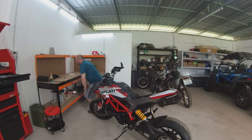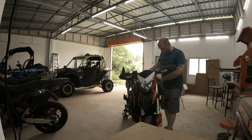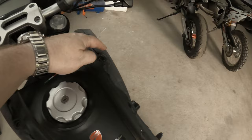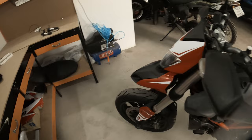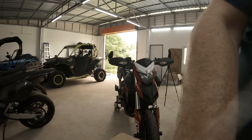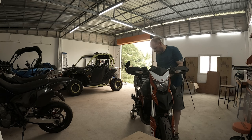Same for the other side. Now I've got to take this top cover off — that's just two bolts, one and two, and it'll come off. I'll take this off — just one, two, and then the fuel cut-off. There's a bit of pressure in there. And then there's another two smaller ones there — try not to drop them in the fuel tank. It just lifts off, easy.